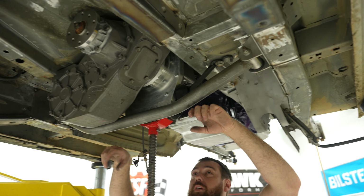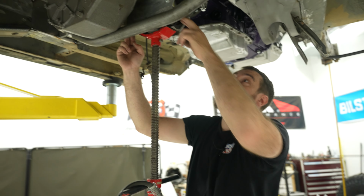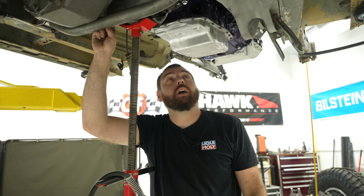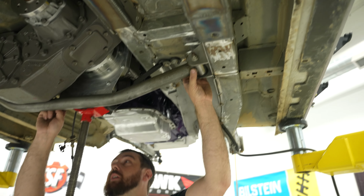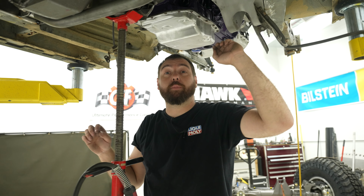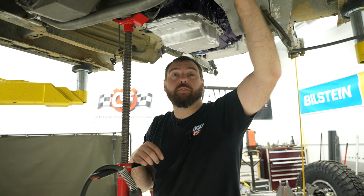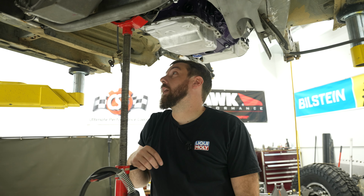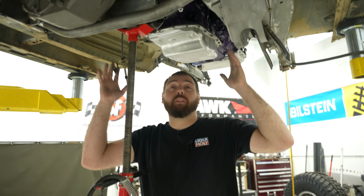This is a big chunk of 120 wall, 1¾ inch. And then I have that tied into the giant plate here. So I just have to sneak up on it. It's a little tight. This side isn't welded, so it's kind of wedged up in there. It fits nice. I just don't want to preload this bushing because it'll make it hard to put a bolt in later. So I'm gonna just kind of finesse this a little bit till it fits just right. And hopefully we can zap it together and then we'll have the mounting figured out.